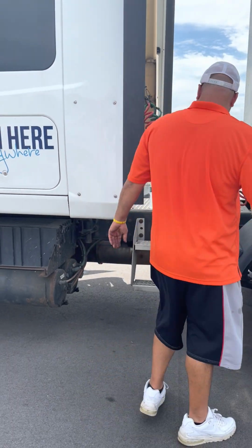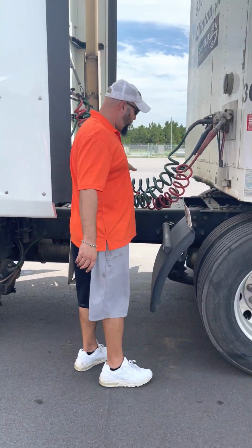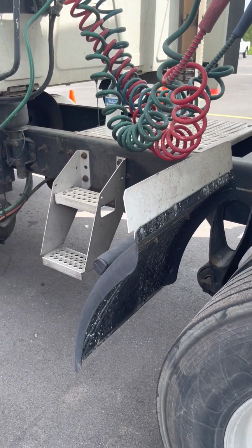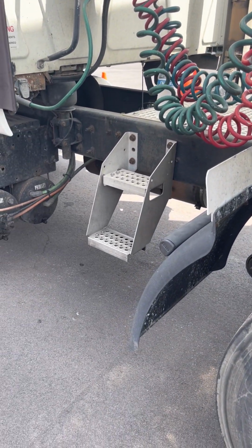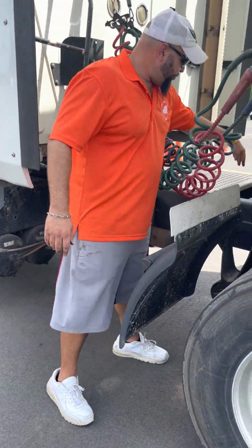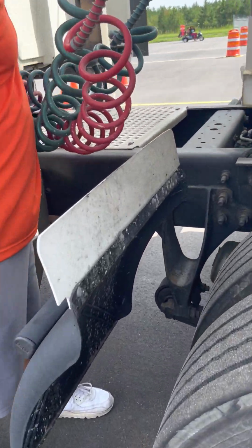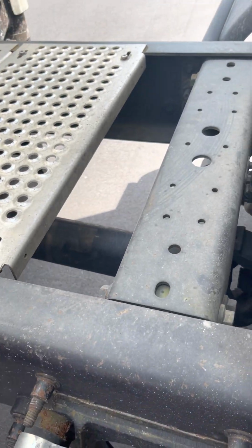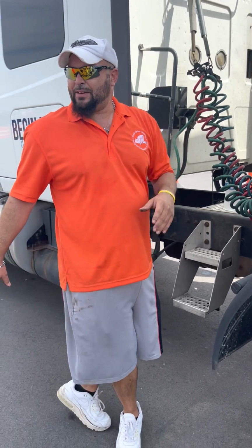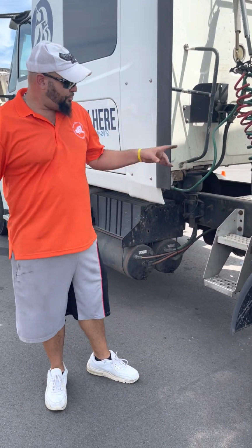Now I'll come to the back of the truck. Got my catwalk area. Do my steps in my catwalk. Same thing as the steps. Not cracked, broken, no missing bolts, free of debris. Got my drive shaft next, running down the middle of the truck. It's not cracked, broken, no missing bolts, no shiny metal in the U-joints. It's got 2 big U-joints down there.